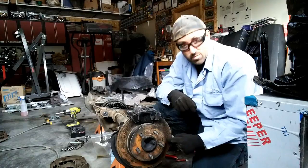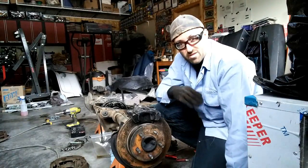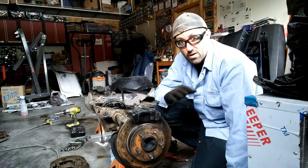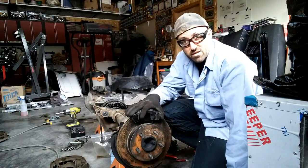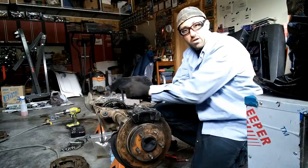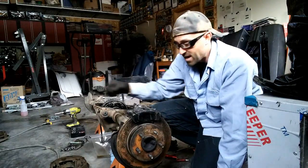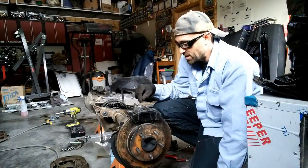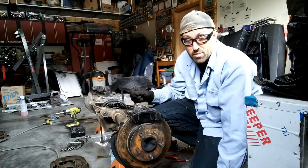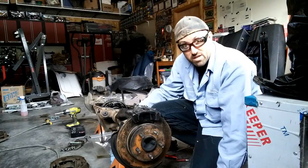The next pieces to go on are your brake rotors. The ones that came with it had some surface rust so I scrubbed them off and will clean them more later, but I want to get them assembled and get the car off the floor. The calipers are also from the '97 GT — they have a left and right hand marking. The caliper bodies with the springs go inboard. The bleed screw is at the top of the caliper so air can go up and out when you bleed it. If you have your conversion parts to hook up the hydraulic line you can do it now, otherwise plug it up and come back to it when you have the parts to convert from Fox body to SN95 calipers.